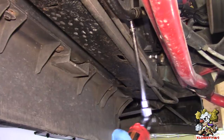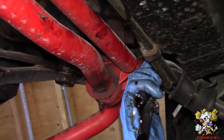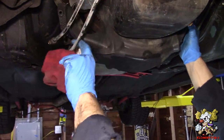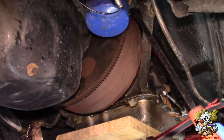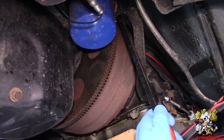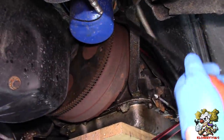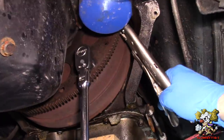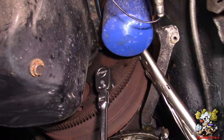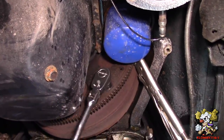Do the transmission line. Get the torque converter cover off. Now I'm gonna unbolt the transmission. I use a pry bar here and just turn this until you get the bolts lined up. Now put a pair of vice grips here so when you're cracking loose that bolt the flex plate doesn't turn. That's a 15mm and it comes off just like that. Now undo the rest of the bolts on this.